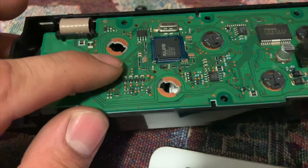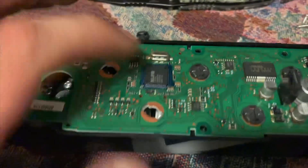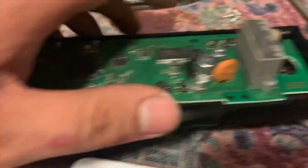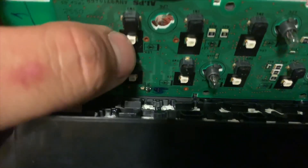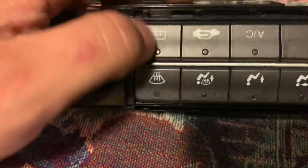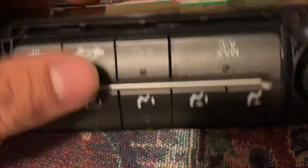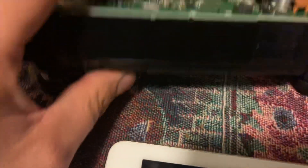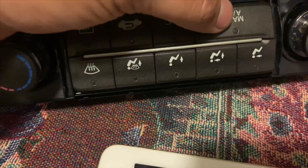What I'm gonna do is use some LEDs I have from my cluster and try to solder them here. If you're curious, by removing these four screws right here — be careful because they do have some ribbon connectors — you can just flip this to the side and there will be some LEDs right there. Those LEDs are for the little window indicators, and they're like orange-ish.